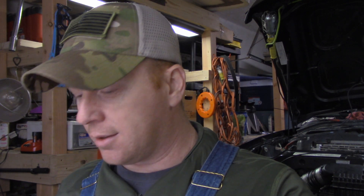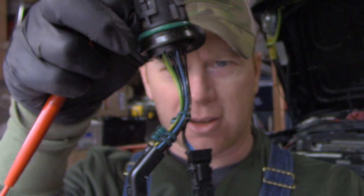Basically the wires are color-coded, so what you're gonna do is take an ohm meter or a volt meter in ohms mode. Whichever one is questionable, you'll touch one lead to one side of the plug that plugs into the fuel injector, then find that color on the actual harness. They're all color-coded — you're basically just ohming out a wire. It's fairly simple. I'm going to turn the camera down and you guys can watch me do it.